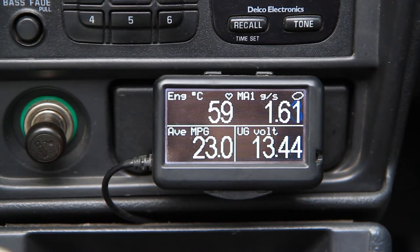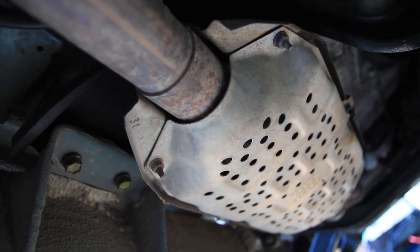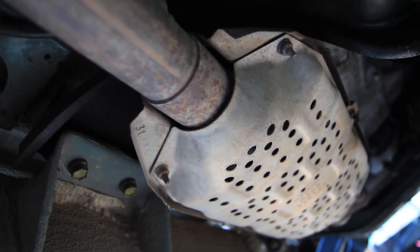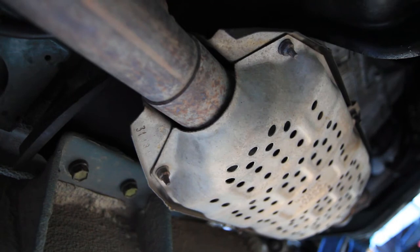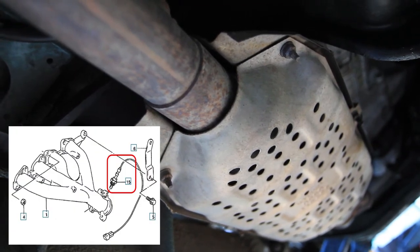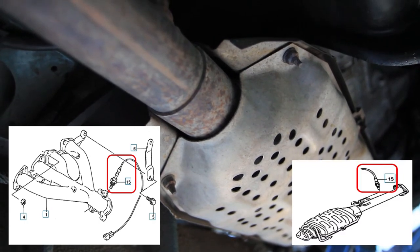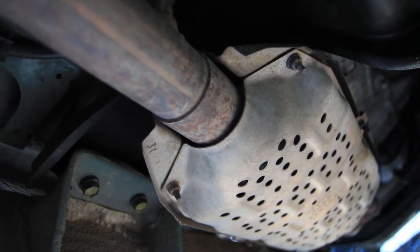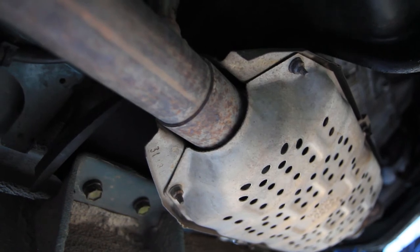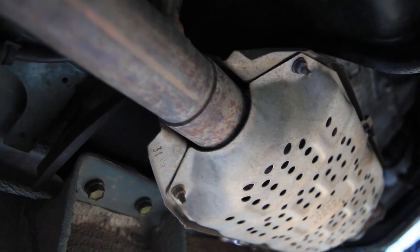At that point I thought I was good to go with all the engine fixes and started on other planned improvements and mods for the truck. Only a few days after passing the emissions check, other codes started showing up. The first was P0420, indicating an issue with the catalytic converter. The Sidekick uses two O2 sensors — one in the base of the exhaust manifold and another after the cat. The ECU is looking for a difference in readings between these two sensors, indicating that the cat is functioning. When I opened up my factory-appearing exhaust, I found the cat was empty — someone had gutted it, likely after it became plugged while the engine was running out of tune.